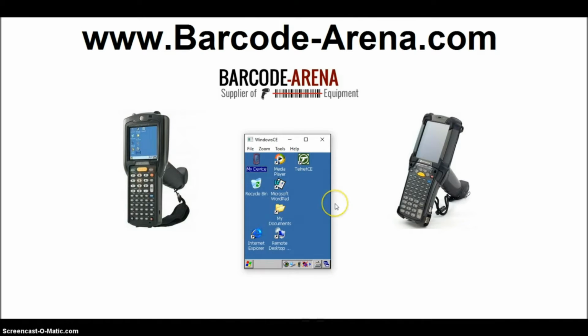This is a 9190G I'm running on. It is factory state. So this walkthrough is from scratch when you first boot up the device, what you need to do. We'll try to make this quick as always, so let's go. Right here in your bottom right corner is your Wi-Fi radio icon. This is where you will always go to configure Wi-Fi on the device. When you first boot up the device, you have to make sure you turn the radio on because it is shut off by factory state. We'll let that kick on.